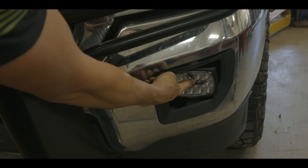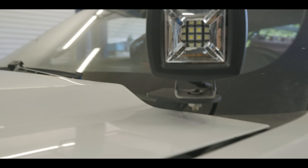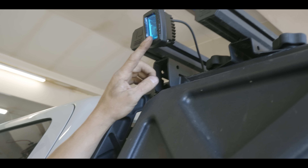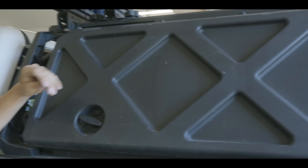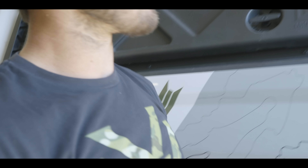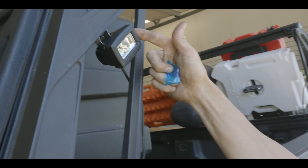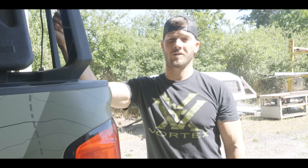This is the Striker — we're going to use that for a fog light on its own switch. That Rock 40 is going to be used for driving on dirt roads, looking left and right for campsites or having a broader light pattern on trails. The Rock 20 on each side is for setting up camp — opening boxes, working around the truck at night. We have two more Rock 20s on the back for a backup light or loading dirt bikes in the trailer. The switch controls are going up front where we'll put little labels on each one.